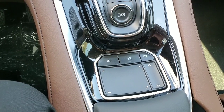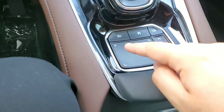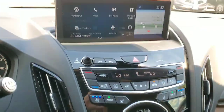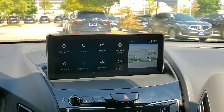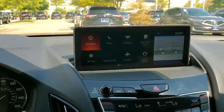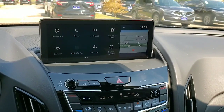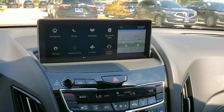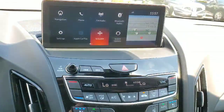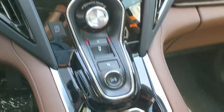A couple of things people get confused about: it's not like a laptop touchpad where you just keep scrolling in one direction. It does not work like that. The way it works is — you see on the top left of the screen you have navigation. All you do is press the top left of the touchpad to correlate with that position. If you want to activate Sirius Satellite Radio and it's towards the bottom right of the screen, you touch the bottom right of the touchpad. It's one-to-one — just think of it as a tiny version of the screen up there.